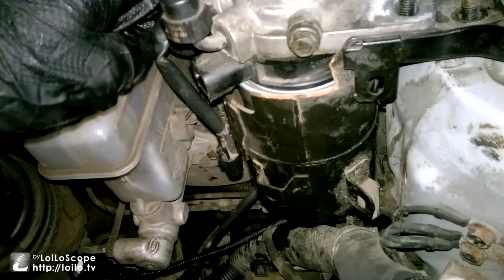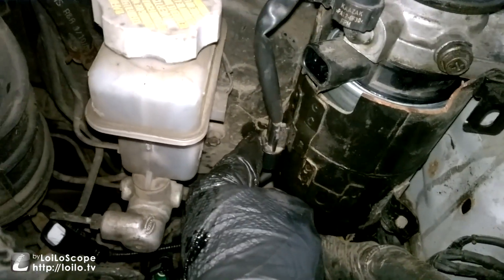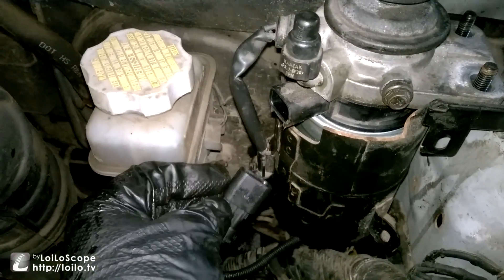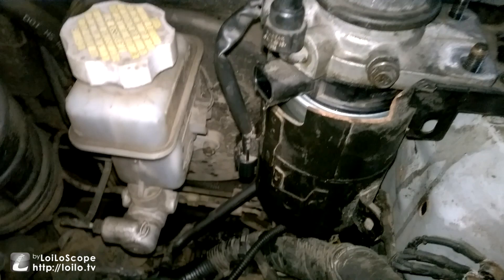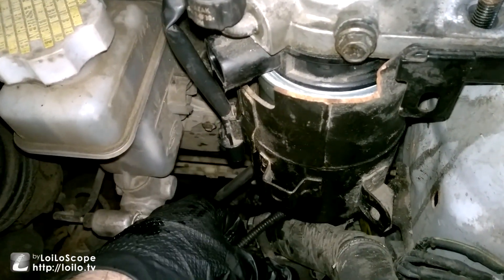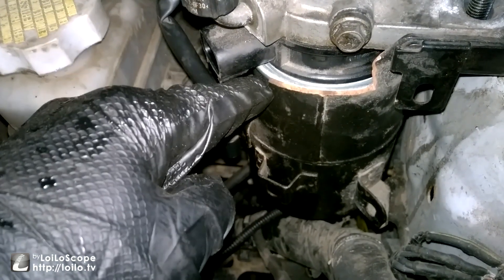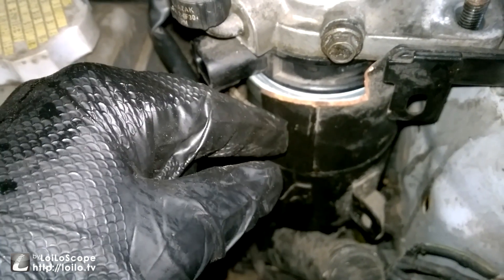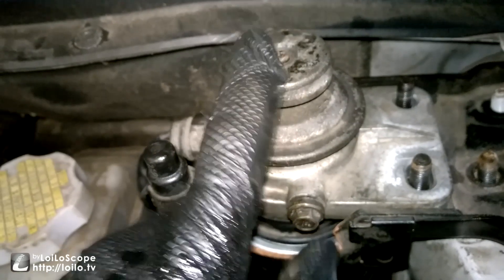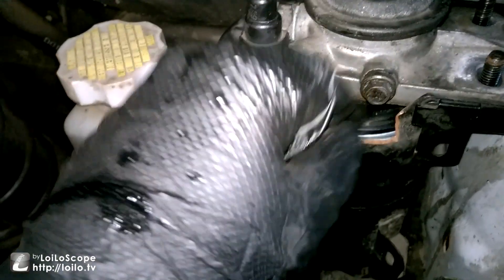The new filter is in place. I'm just popping it back down again — electrical connections — and fitting it back into its holder. Connect up the fuel pipes and then reverse order to fit everything back together. One tip: make sure you fill the fuel filter up to three quarters or near full with diesel — it helps. There's a primer here, but if there are any issues with the primer, it can be very hard to start if the fuel filter is empty.